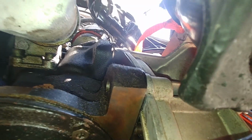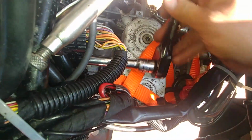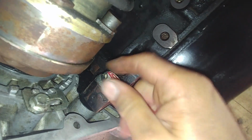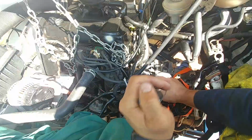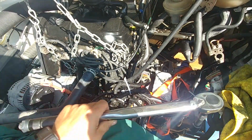As you can see, the torque converter studs are in that drive plate already. Alright, you see that's all coupled, it's connected, there's no gap. Bolts are just tight enough to hold the transmission in place. So we keep tightening. I go in a star-cross pattern, up on the bottom, on the top, and next on the bottom, on the top. Just pull it equally, and then you torque them.